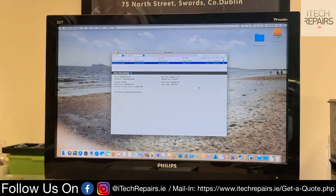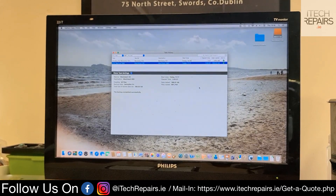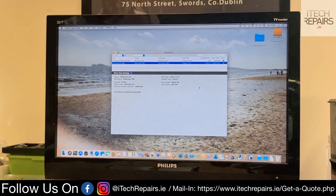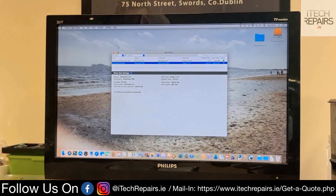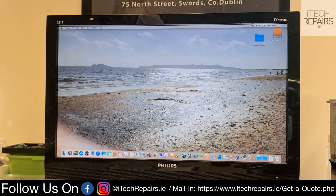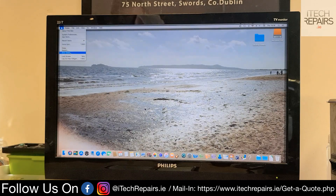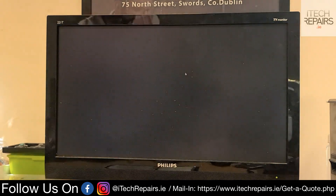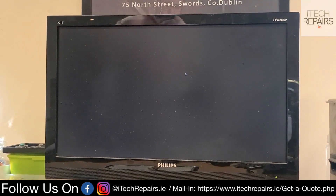The cloning process is finished. As you can see, it took about an hour and 55 minutes to clone the main partition and then about a minute and 21 seconds to clone the recovery partition. After this, you just turn off your Mac and start replacing the drive. You can also boot from the external drive to verify, but given that I've used this program so many times, I'm simply going to replace the internal drive.